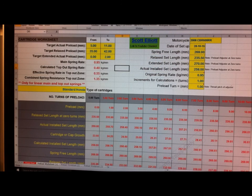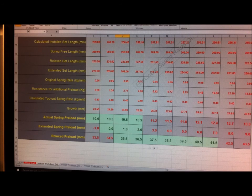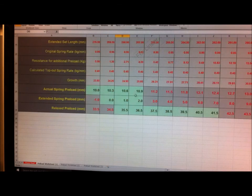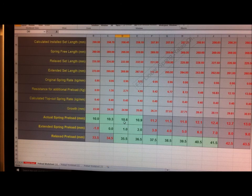I'll make this a bit smaller so all that data is in there. I've used conditional formatting - what you're looking for is three lots of green: the actual spring preload, the extended preload, and the relaxed preload. If they meet those parameters, the cell will turn green. In this case I need to be running the preload adjuster between two and three turns. Two turns gives me 10.6 millimeters of preload on the spring, my extended preload will be one millimeter, and my relaxed preload will be 35.5 millimeters.